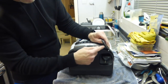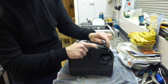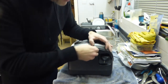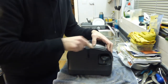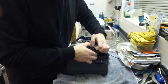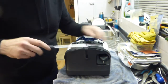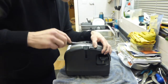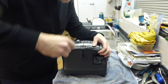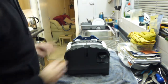So what you're trying to do: you're trying to get that clip and that clip into these holes here — you can see the holes in the case for it underneath. One in, two in, three in. Push it down slightly so it goes underneath here. And if it doesn't want to go straight away, get your screwdriver. Because it normally will go in the end. There we go, and that's gone in.